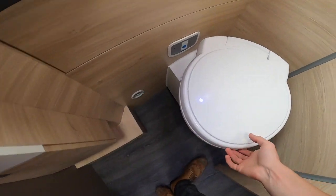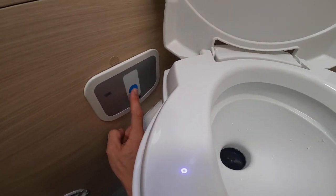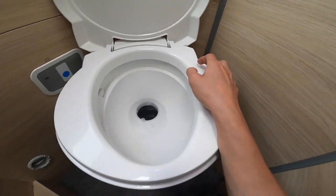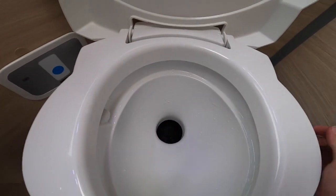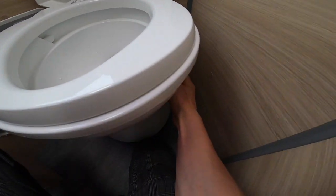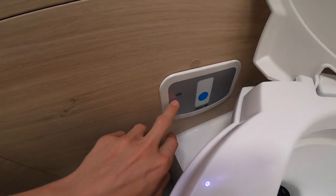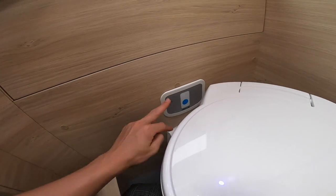In the washroom you've got your toilet. As long as your pump's on you can press the blue button which is your electric fresh water flush. Always flush the toilet first as it lubricates the seal on the blade and stops the blade from sticking. There's a grey lever — slide that to the right and use it with the blade open. After use, flush and then slide the lever to the left which closes the blade, allowing you to get the cassette out of the vehicle to empty it. There's a light on here when the cassette is full and requires emptying, cleaning out, and topping up with chemical.